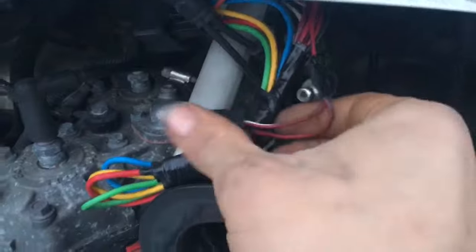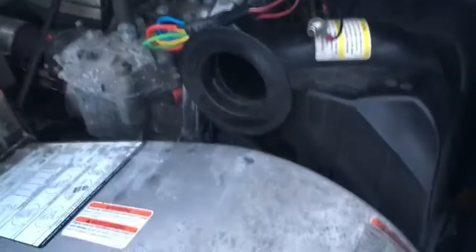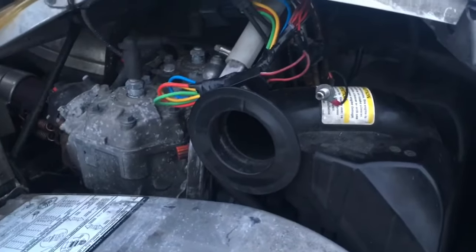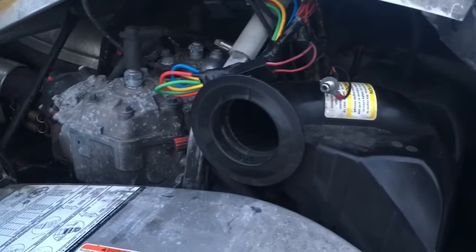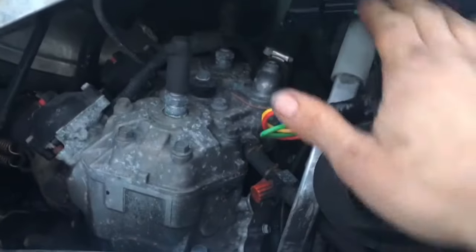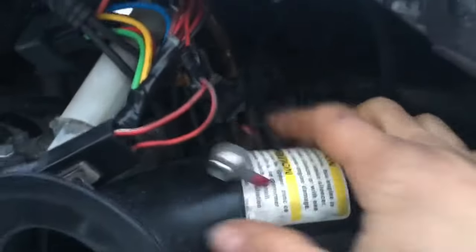And if you still have a problem, look down there for corrosion. And I'll have talked about how you undid the 7-pin that's up inside here, and it'll show you that in the wiring. And you're going to take the whole thing out. If you're having any issues with your skidoo or your Rev, it doesn't matter if it's 550 SS, 600s, whatever it is, the wiring on these snowmobiles is actually really super simple. It's not very complicated. You can just follow the wires down to where they go. And anytime you're working on electrical, you're going to look for points of corrosion. And that's exactly what I found. My relay was all corroded. The wiring harness was corroded. And like I said, you'll see that here in a second. And you're just going to repair it and rewire it in there and cut out the corrosion.